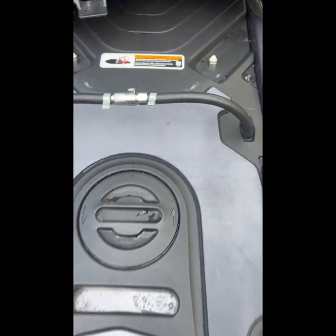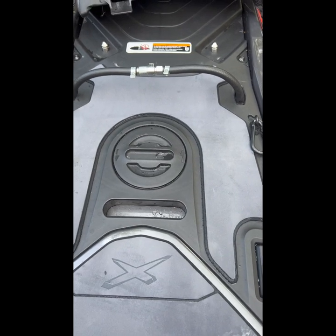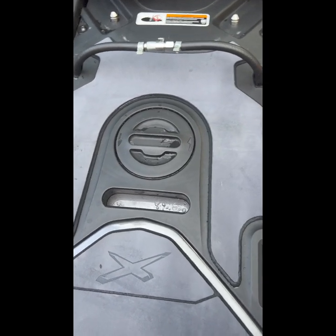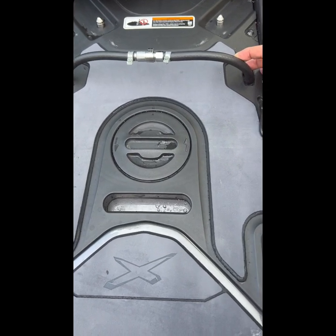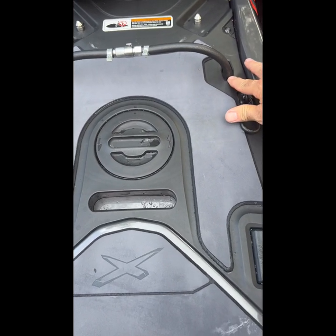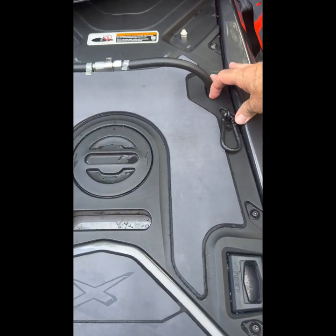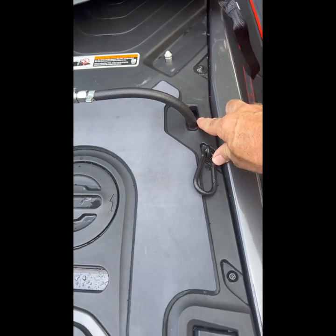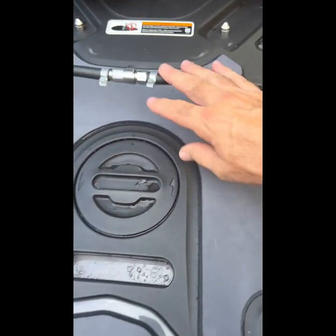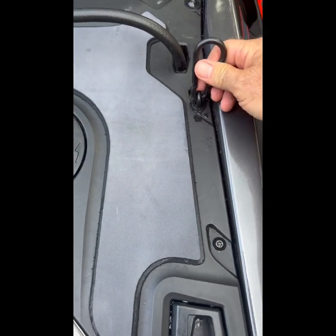I've done several different designs on several different skis for the placement of the fuel holes coming out of the engine compartment. In this particular ski, I went towards the back — I think that's the pole for your ski pole, one of your sides here. I just took and cut out the bottom side and put it on the back. This is a 6mm bolt with an eye on it and a carabiner, and that's what I use to hold my gas tank in place.